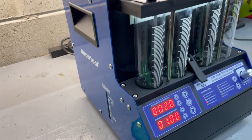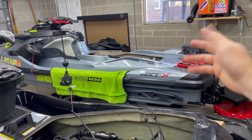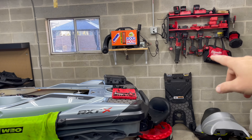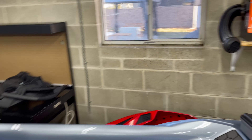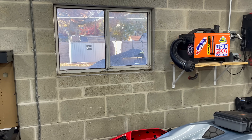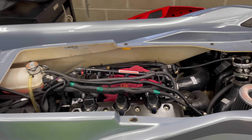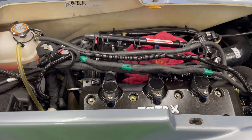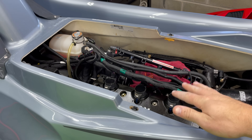So I'm going to go ahead and take these off the test bench and put them back in the ski. But before that, I'm going to fog the intake valves. Now I do have right on the other side of this wall a 2021 Sea-Doo GTR that's wrapped up. That has around 150 to 160 hours. So I may do an injector test on that because at this point it's a four or five-year-old ski with almost 200 hours — to me it's worth doing an injector test.